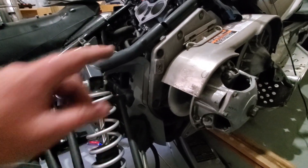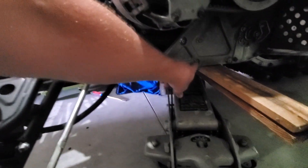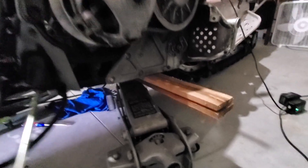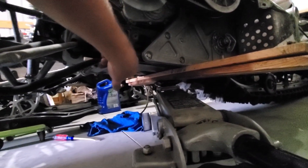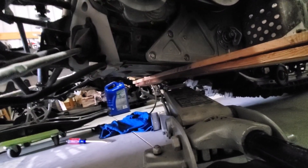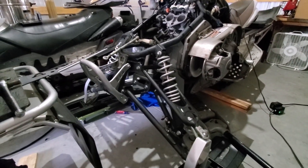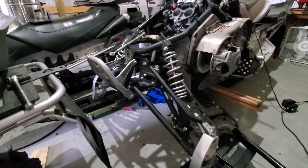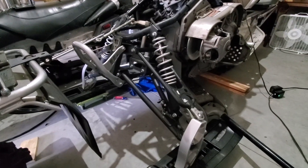And then on the left side, we're going to remove this bolt, this bolt, this bolt, and this bolt. I placed a jack underneath the sled to support the front of the tunnel, but not so far forward that it's on the belly pan — it's right where the track comes out from under the bottom of the sled, and that's supporting the entire front of the sled right now. So I'm going to remove those bolts, and then hopefully the skis, the A-arms, the shocks, and all the steering components will come completely off the front of the sled, and then we're going to drag them over to the workspace.